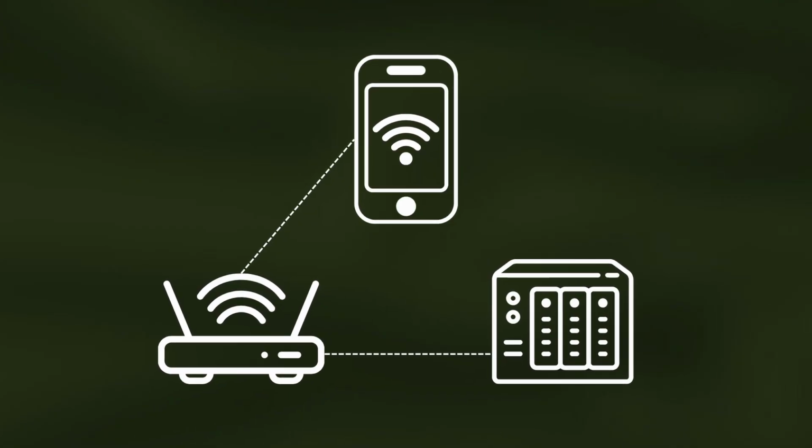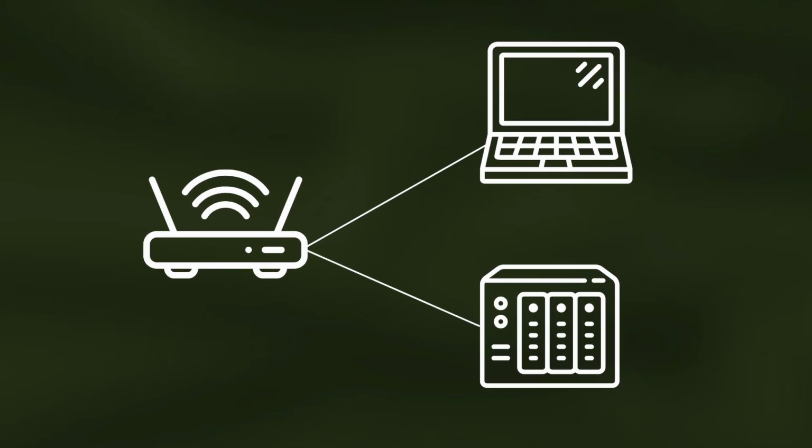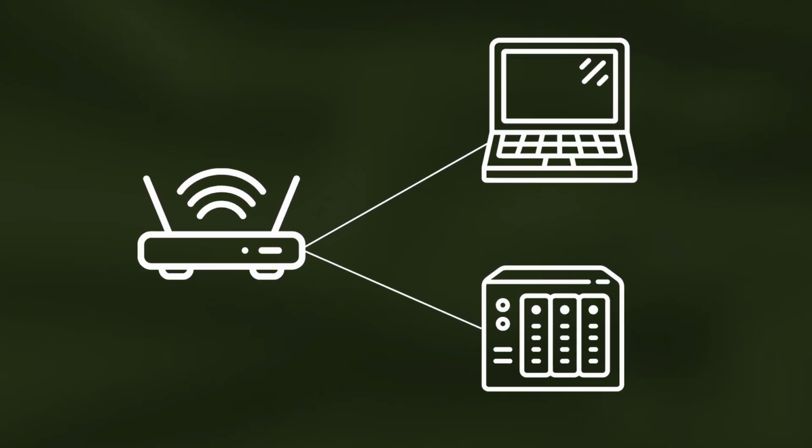As I already said, your network speed doesn't have to be the bottleneck of your NAS transfer speeds. If you're connected through Wi-Fi, then yes, it will be, but the reason building a NAS setup makes perfect sense in the first place is the fact that the data can flow through the Ethernet cable without ever going through the internet. The way to do this is to connect your Raspberry Pi and your computer to a router or a network switch. So that means that I just took two cables and connected my NAS and my computer to the router, and that was it, right?